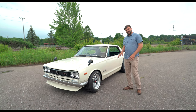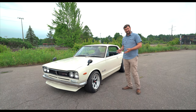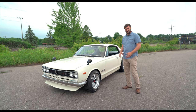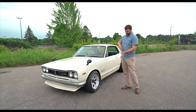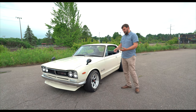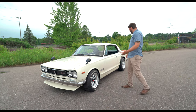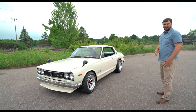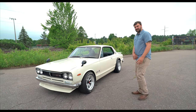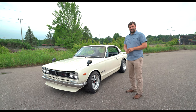So no cut front fenders. We kept the suspension as a 280ZX front strut modified with T3 coilover top hats and Koni yellows. That lets us set the tire in more without having to cut the front fenders and still run a modern tire. Kind of the same thing in the rear — a much bigger tire inside the fender with modifications to aftermarket struts, aftermarket springs, and helper springs in the back to set the ride height.